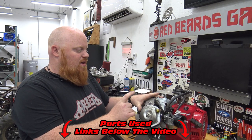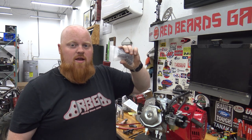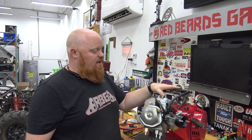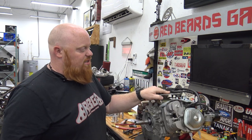I'm almost positive I have 50-pound valve springs in this, but we have some double springs from Go Power Sports so we're probably going to upgrade to those as well. We're going to start tearing this thing down. Half our work is already done — we've got the governor removed but we are going to be disassembling pretty much everything. Let's do it.